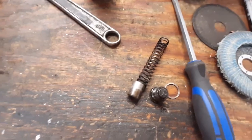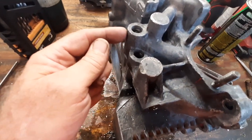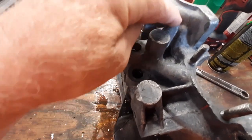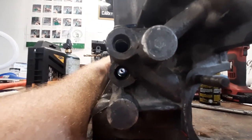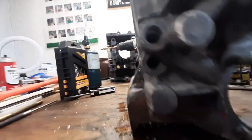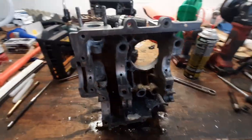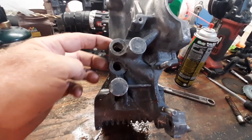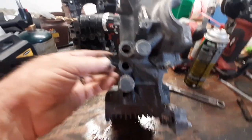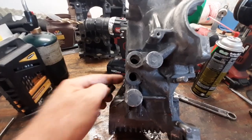I got the piston out. There's the little piston — this goes on the end of that spring. I was a little off on the actual oil path: it goes through the cooler normally until it pushes the piston down, but it doesn't go up to this — it exposes the other side of this hole here. That is the main oil galley, the one that comes out on the back side of the case that we'll be plugging. From there it flows to your bearings and then back up. The piston normally blocks that port completely off, then it starts pushing down because of extra pressure and starts flowing straight down the galley to the main bearings.